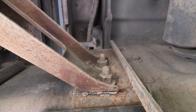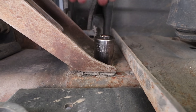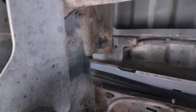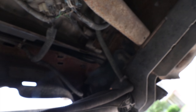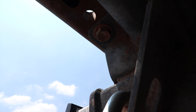We're going to go ahead and zip these nuts off here. These two are 18s — they connect over to this side and that goes to the bumper. Then we're going to do the same thing on those two over here. On mine, I've got a tow hitch and I've got to get this off — I'll figure out what size that is in a minute.